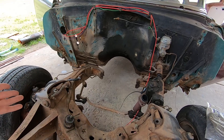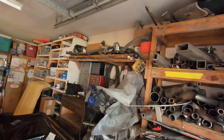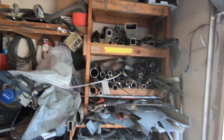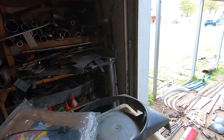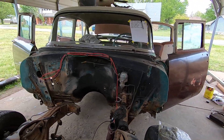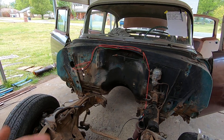I want to do the side engine mount setup on the car and get it figured out where it needs to go. Then I'm going to build my own crossmember — I've got a bunch of steel up here, either this piece or this piece of square tubing. I'll build a mount pad out of another piece of square tubing and do some pieces of angle on the sides of the frame, building pads on the end with drilled holes so it can unbolt and bolt in.